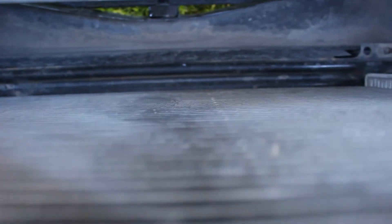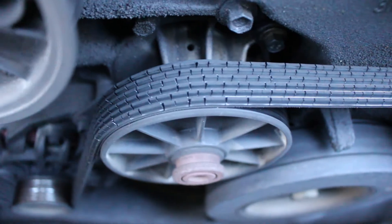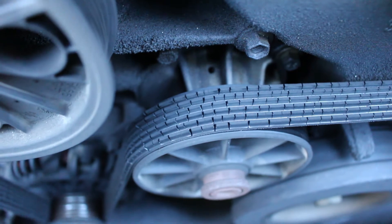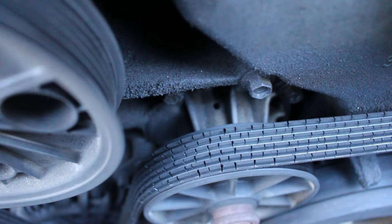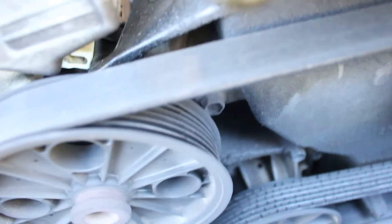I've removed the fans, which we'll take a quick look at as well. There's your radiator in the front, so the air can pass through it and cool things down. Going in and out of that radiator, you've got a lower hose here which comes out and feeds into your water pump. That's the pulley on it, being driven by the serpentine belt. Within that water pump is a mechanical propeller. As the engine's on, it'll turn that belt, it'll turn your water pump, and that will push the coolant through the engine via a series of coolant galleries or channels.